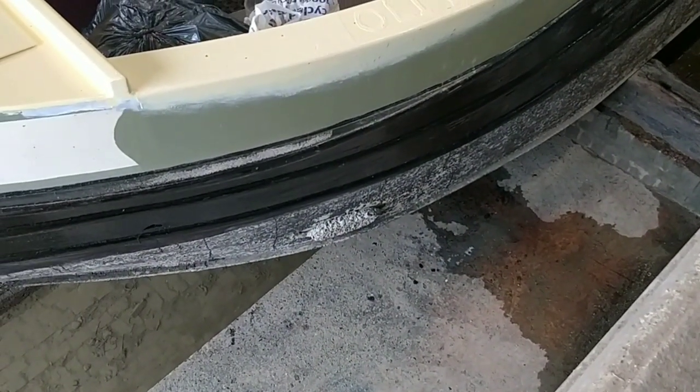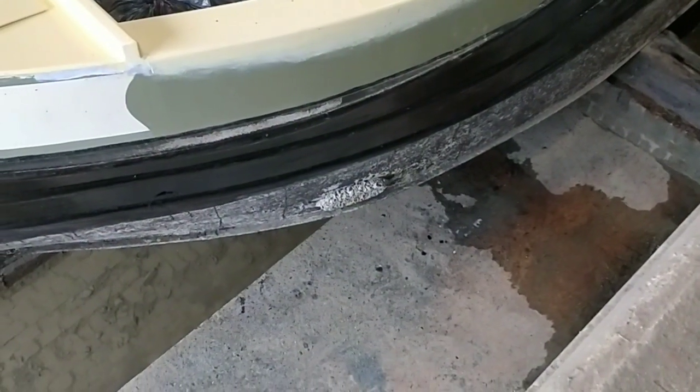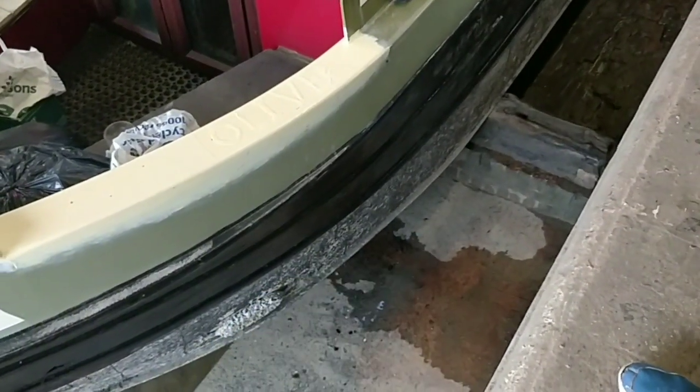I'm going to weld some above, leave that one on. Yeah, we've got plenty of meat. I'm going to put it just behind or on top of it. Just behind, yeah. If you go any further forward, it's going to mess the steering up, I think. We've got plenty of the sacrificial line left. See that sticking out bit, we call it.